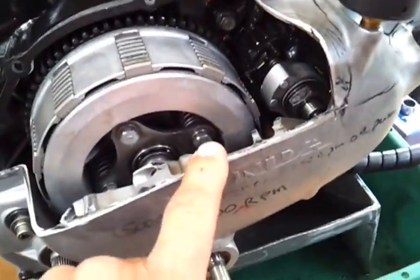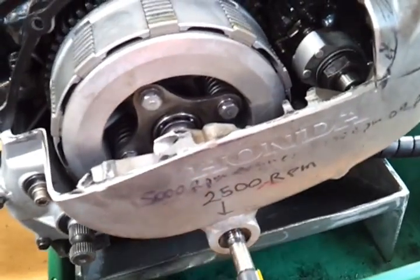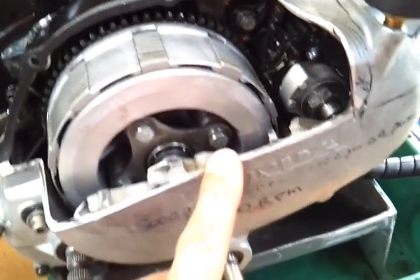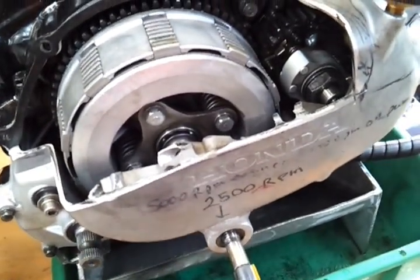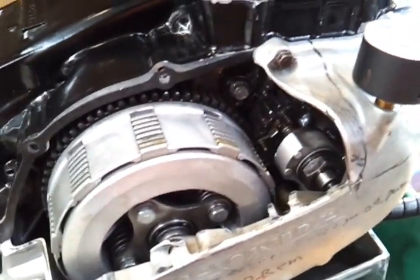The only thing we've done is bypassed it and allowed it to get some decent oil filtration. The oil pump itself, we've machined every surface that there is to machine, re-bushed the back of the pump where they just normally run in aluminium. These things are getting 30 years old, so they're hard to find good pumps. We've made brand new oil pump gears for them, and actually made high volume oil pumps as well, but it turns out you don't need the high volume oil pumps because they've got loads and loads of flow, as you'll see soon.